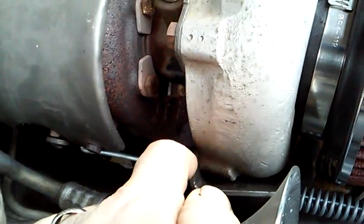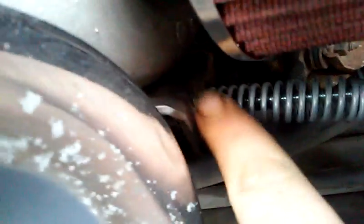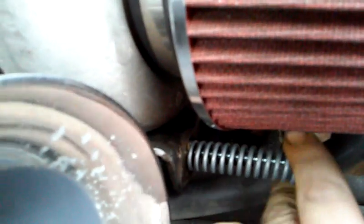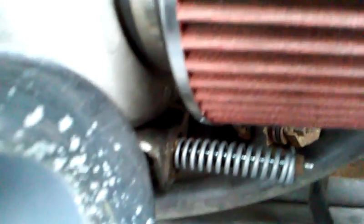What I did was, this is a stock mount for the stock wastegate. All I did was come over here and where the wastegate was, I cut it off with the sawzall. I grinded it a little flat just so it had a good place to sit. And this washer right here — went to the hardware store. Basically any hardware store should have a bunch of different springs. Just find a heavy duty one, think of like a valve spring — something that's going to be rugged.